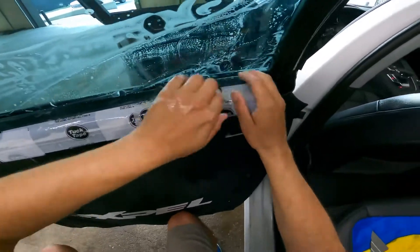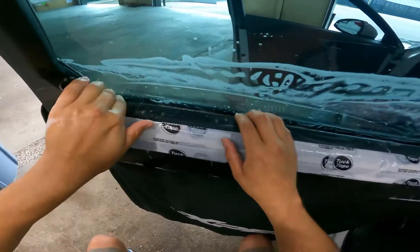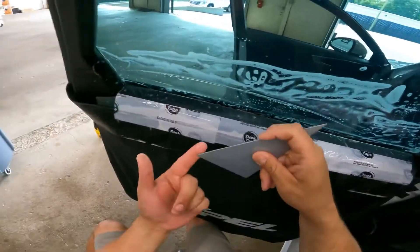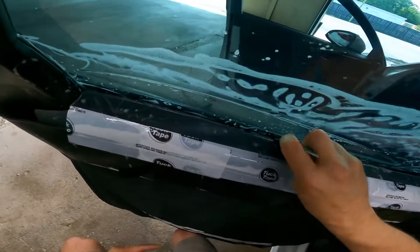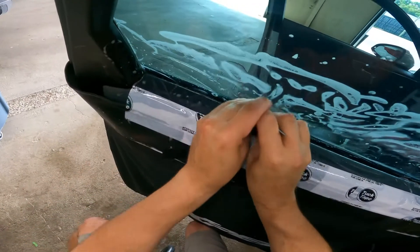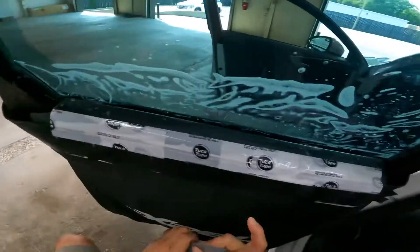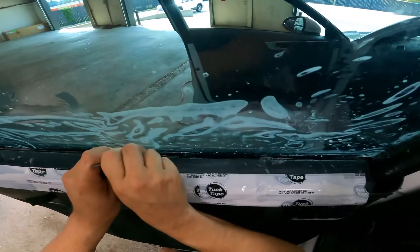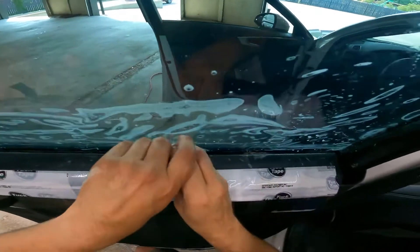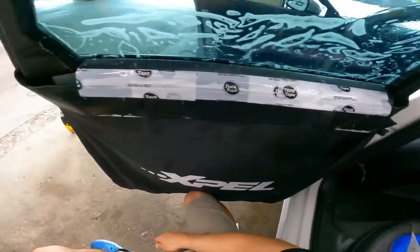These outies are no joke. The film is sitting right above that door seal. Remember I need two points of contact — one, two — get that all the way in there, flex this back, and then my other hand is just going to go over the top, tucking the film behind that gasket. I surprised myself on that one — these are tight seals. If you come into an area where it's really tight, flip it around and use this side — that went right in.